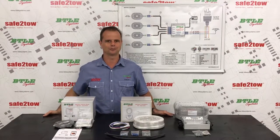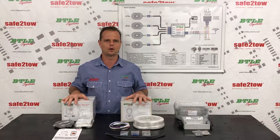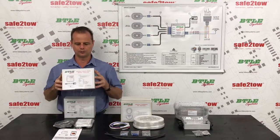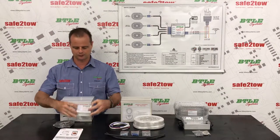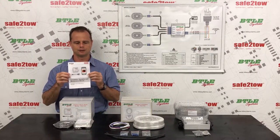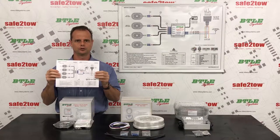Materials. I've reconfigured my display here and I've also got a wiring diagram for a dual axle brake monitoring system on the wall just to help explain where our materials are used. What I've got on the desk here is the materials that will typically be required to do a brake monitor installation — it'll also require some other consumable materials, but I'll talk about them separately. The first thing I've got here is our brake monitoring system — we've got a dual axle and a single axle system. Inside the packaging is our brake monitoring unit, which mounts on the underbody of the caravan or trailer, and the Bluetooth communication module, which communicates with the brake monitor app on your smartphone or tablet. Most importantly, inside this packaging is your installation, operation and maintenance manual. On the center page of all our manuals is the main wiring diagram for your brake monitoring system — this dual axle wiring diagram on the wall is identical to the one inside your manual.